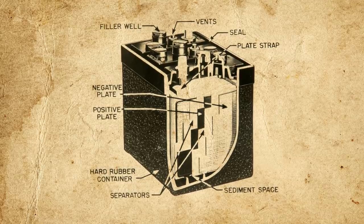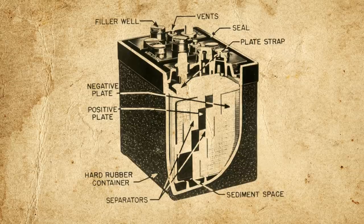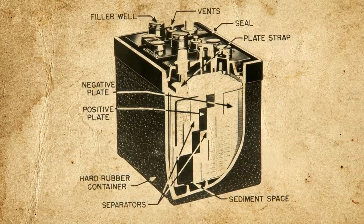Between the carbon and the pores, together with moisture and a concrete floor, this could potentially lead to a path for the electricity to flow, resulting in the battery draining. Today, all of these automobile battery-destroying or current-conducting flaws have been eliminated by using plastic shells around the various types of battery designs, and the potential problem of damage to the concrete floor from battery acid leakage has also been mostly mitigated, as previously noted, by Interstate Batteries.